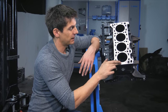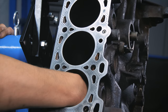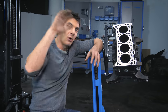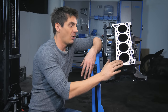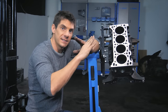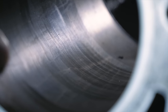The surface inside the cylinders is vital because the piston moves up and down. We want minimal friction and the piston must run on a film of oil — we don't want the piston rings contacting the cylinder wall at all. On one hand we want the wall to be perfectly smooth to minimise friction, but if it's too smooth the oil simply falls off the walls. So there's a cross-hatch pattern inside the cylinder formed by a process called honing — ideally a 60-degree crossover of lines creating a fine diamond shape with indentations that hold pools of oil for the piston rings to run on.